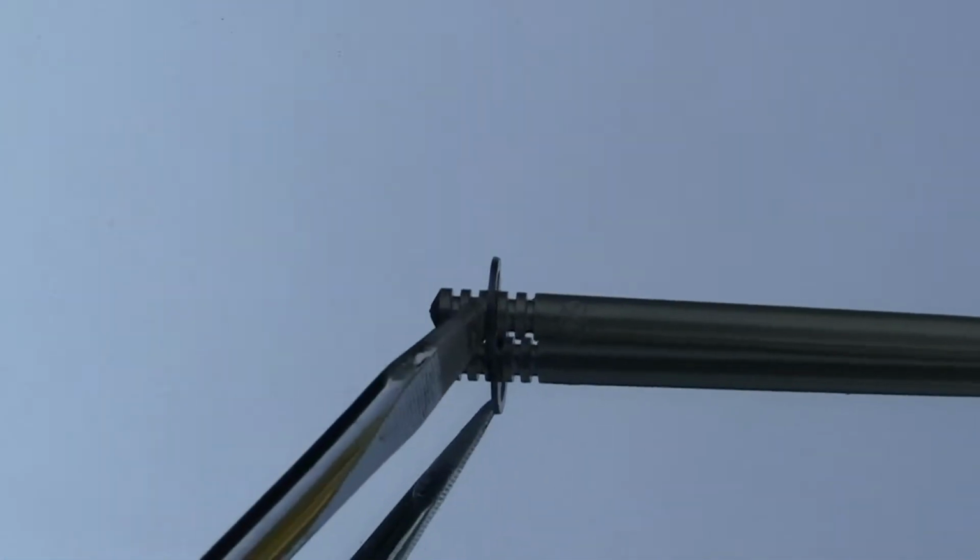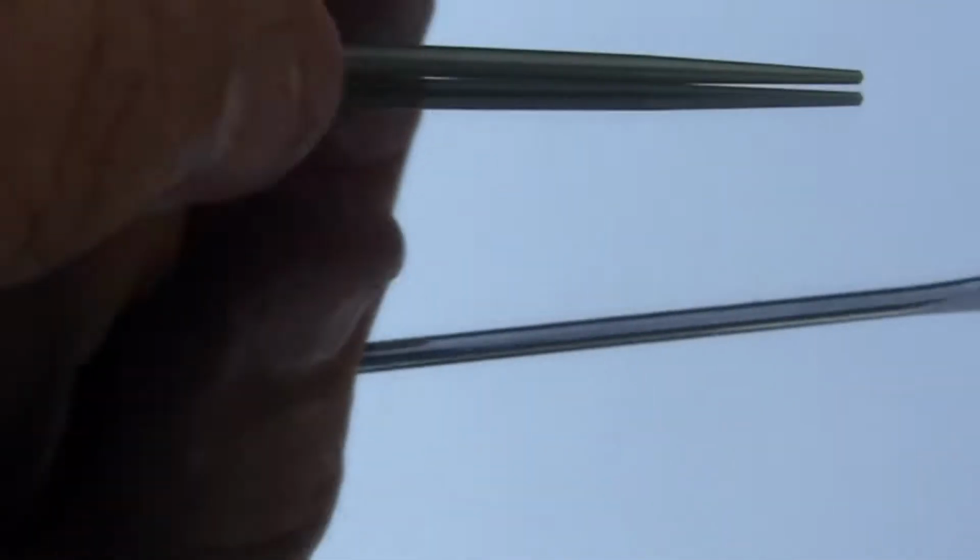For instance, if I have the C-clamp right here, thing's got to be magnetic. Damn it. If I have the C-clamp right in the middle, it's only going to lift this jet so far, and you can see the tapering on it. There's actually 3 tapers on this jet. You can buy different jet needles. I don't know if you can see it, but there's a little tiny number on the jet needle. You can order different jet needles with different taper sizes. What it gives you is different fuel at your low, medium, and high range. Well, not really high range, but anyway.